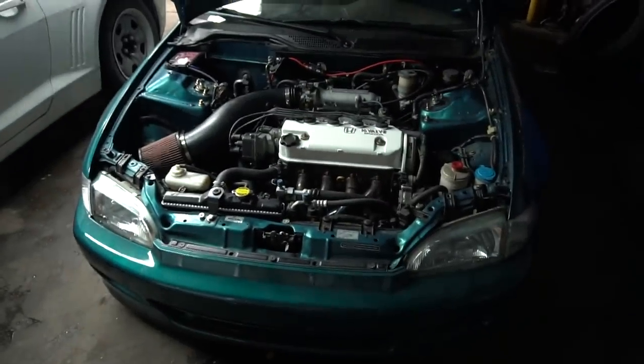In the last video you guys saw that I drove this thing for the first time, which was awesome. It drove fine, drove great, but there were a couple of kinks. Brakes kept going in and out as I was turning — that makes me believe it's the brake lines on either side of the front getting stretched and causing my pedal to just go all the way down.